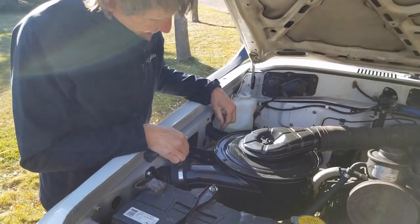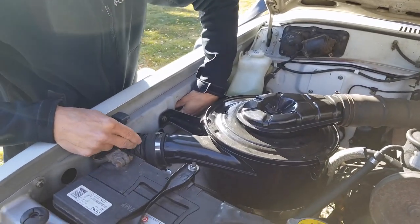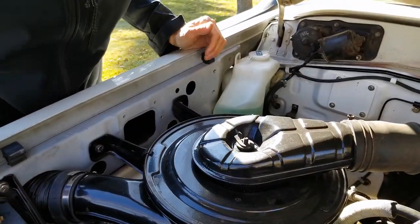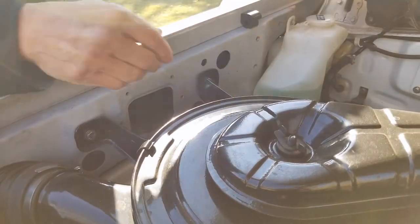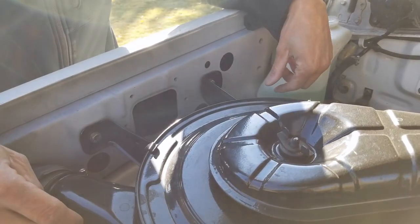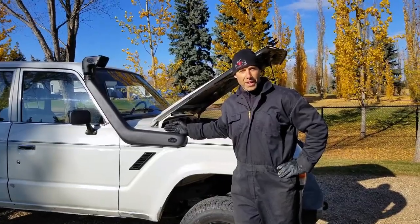Mike explains: we started by disconnecting the air filter and moving it aside. I was able to reach into one of the access holes and extend the adjustable hose, then weasel it into the other access port. For attaching it to the snorkel, I got my hand in and reached almost all the way together with my other hand and married them together. We used silicone spray lubricant to help slide the hose onto the plastic parts. Hopefully you found this snorkel installation video useful - please like and subscribe if you haven't already. Thanks for watching!